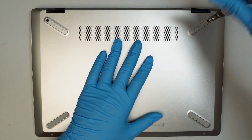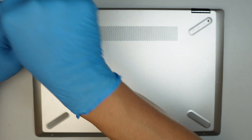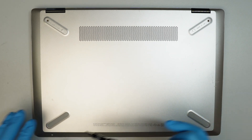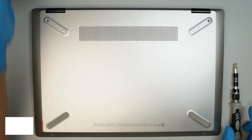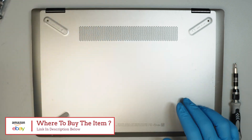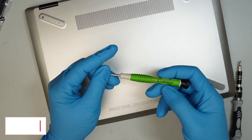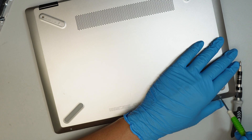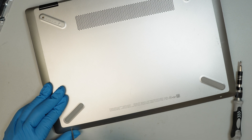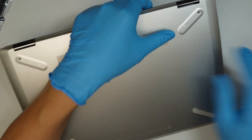Get a Phillips screwdriver and remove the screws. If you're not sure where to buy the battery, check the link in the description below — I'll link it to Amazon or eBay where you can find a replacement battery for this laptop. I'll be using a 1.5mm screwdriver to remove the two smaller screws at the very bottom. The next step is to pry it open.